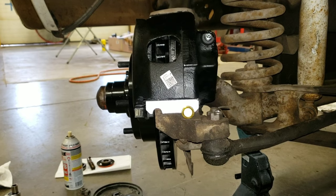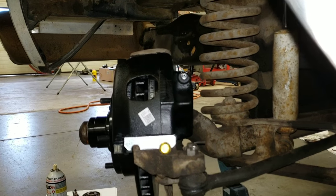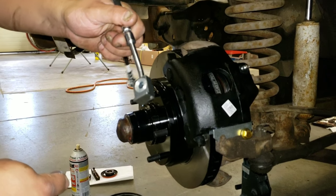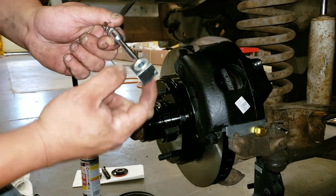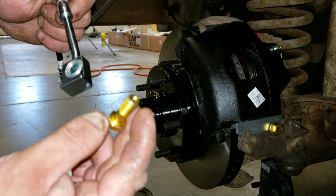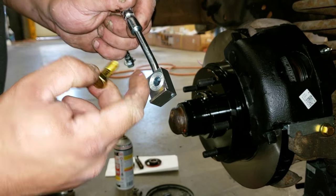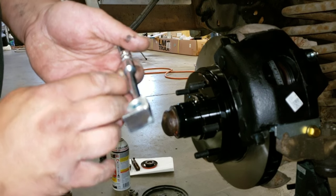Oh, and back again to what's left and what's right, the brake bleeder always goes to the top. So now we're putting on the brake hoses. The way it works is the fluid comes through the hose and out into this block. The fluid then enters this hole in the shank of the banjo bolt and squirts out the middle of the bolt. So to seal it from escaping out from the head of the bolt and the block, you put one of these brass washers in.